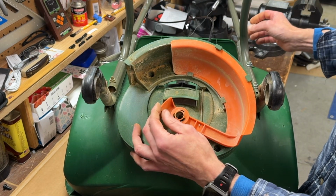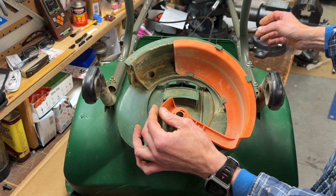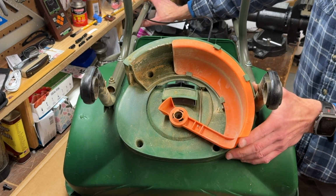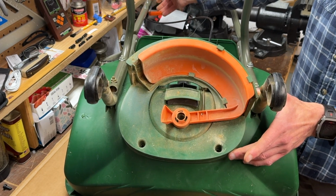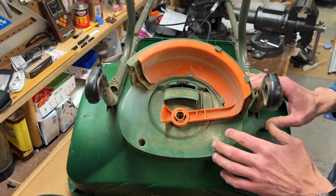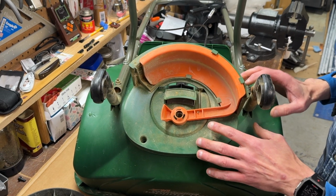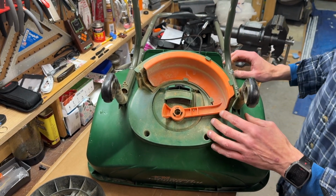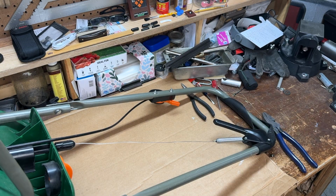In addition, this piece of the edge guard reduces the opening of the chute so that less product is dispensed to the spinning impeller. Makes sense since you wouldn't want the same amount of product being applied while the edge guard's on. A common issue with these spreaders is the edge guard doesn't fully retract, and that's usually due to slack in the cable or bad connection. To remove the slack or even replace the cable, let's go up to the handle mechanism.